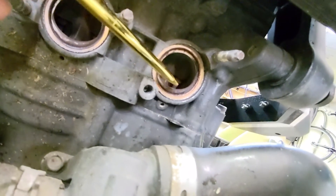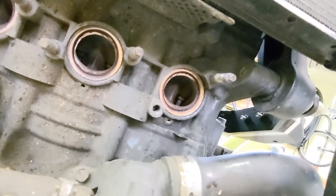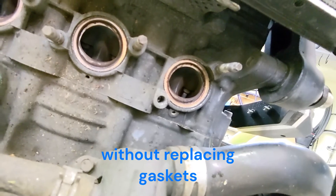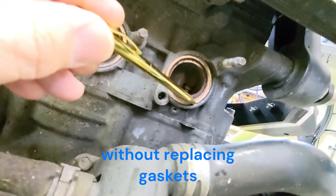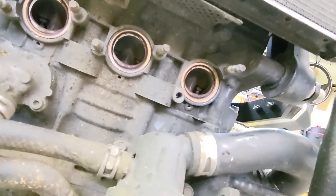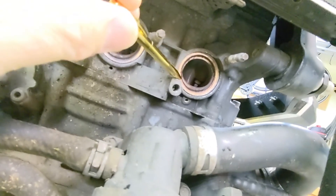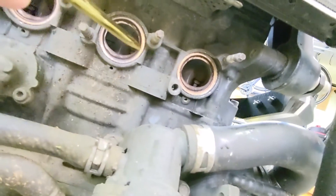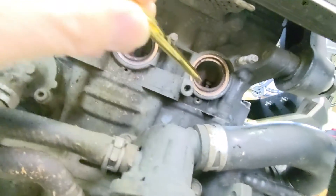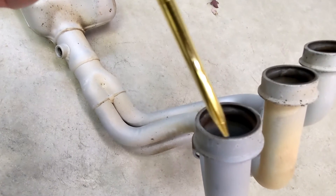The first time I tried this, there was an aftermarket exhaust on it and it was too loud, so I put the stock exhaust back on — probably opposite of what everybody does, but I like it because it's super quiet. When I put the old exhaust back it was totally smoking out of these gaskets, so I had to buy new ones. I've had it off twice since then, and the last time it didn't leak at all because the surfaces line up pretty exactly when you bolt it down.